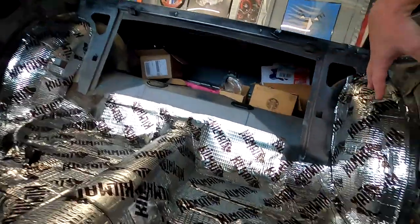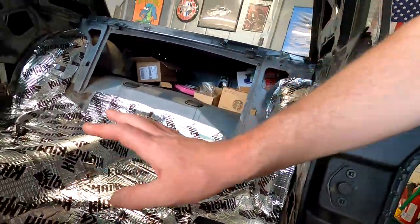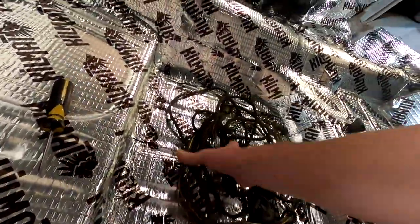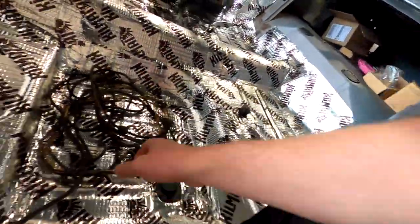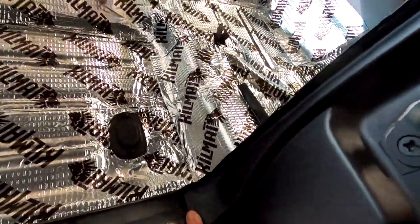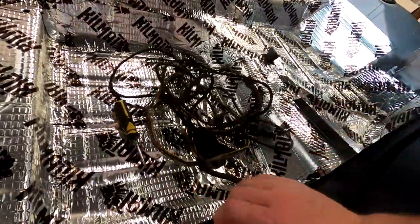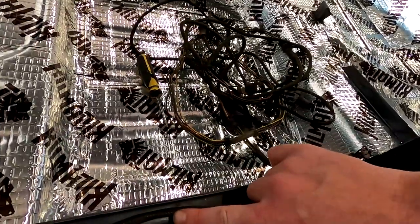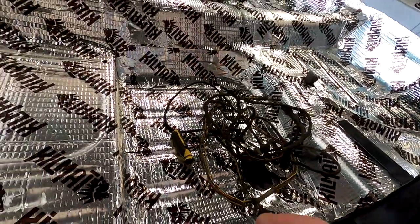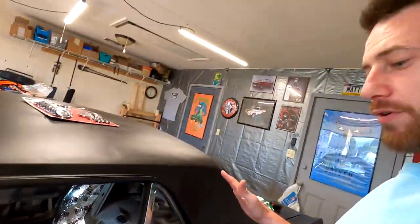If I put the interior in then I won't be able to access any of that. What I'm probably going to do first is deal with the wiring — when I repaired the B pillar I had the wiring out and then I welded the B pillar back in. So in order to run this wiring back through, I'm just going to cut it right here, fish it through the side, and then solder it all back together.